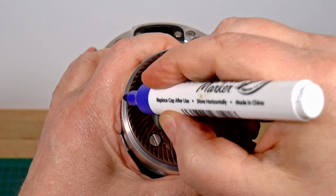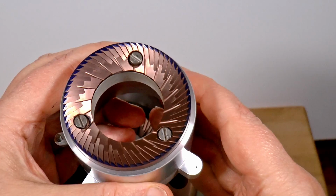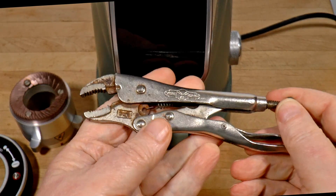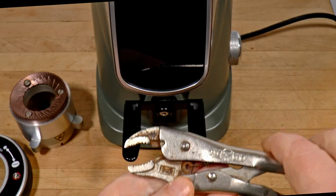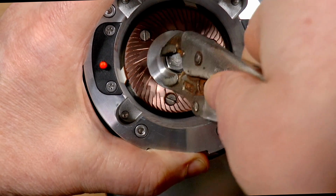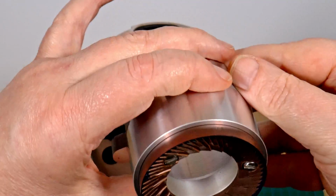I always like to start with the burr alignment ink test because it gives me an idea of how well the components are made and assembled and how strict the quality control is. I like to rotate the lower carrier with small vice grips that make a firm connection with the fastener here so that I can feel the burr contact area as I turn it. Obviously, you wouldn't use this to tighten or loosen the fastener, but for what I'm doing, a socket would have too much lash to provide a good feel.